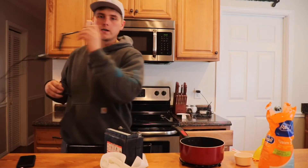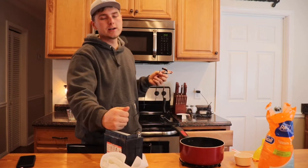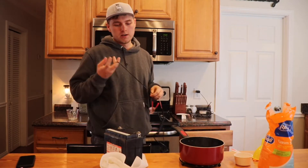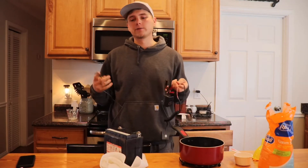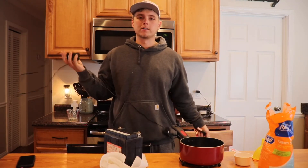Then you're going to take your battery charger and charge this battery for 24 hours, and then you should be good to go. This will work on most batteries unless your battery is extremely old and completely dead.